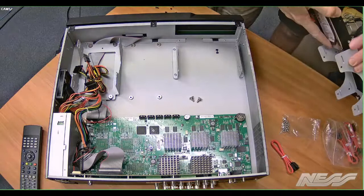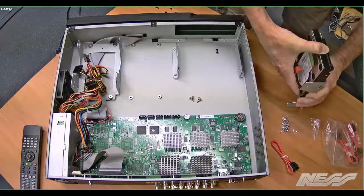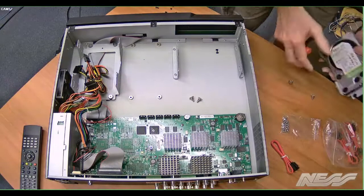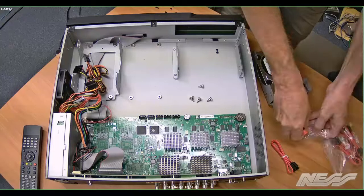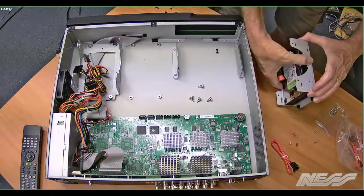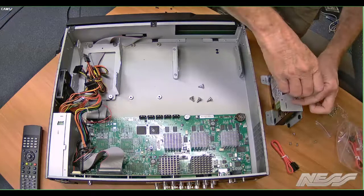Then we slide the hard drive into the cradle — it's a fairly tight fit. Once it's safely into the cradle, just reasonably gently get that in and then align the screw holes up for the hard drive. There are four screws to go in, two on each side of the hard drive. The holes are in a very specific position for it to mount in, so you'll see those there. Once they're lined up, you can just put your screwdriver in to line the holes up precisely and then proceed to put the four screws in.